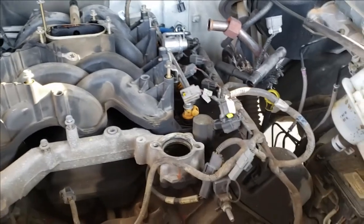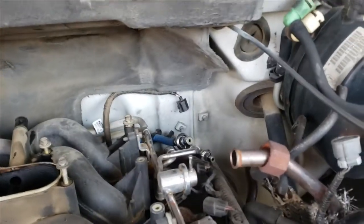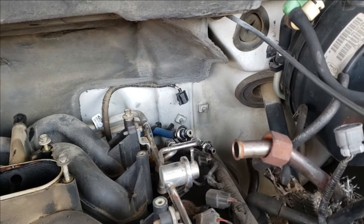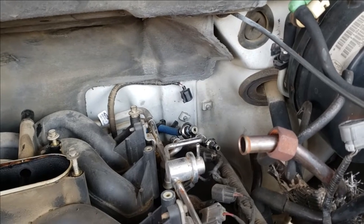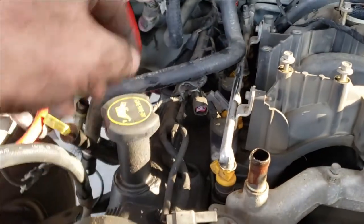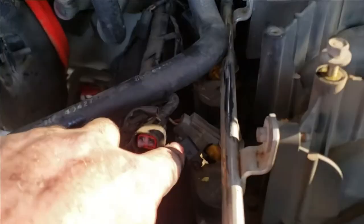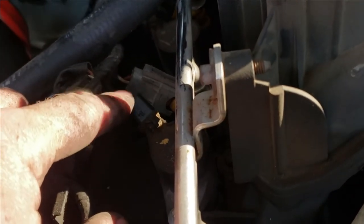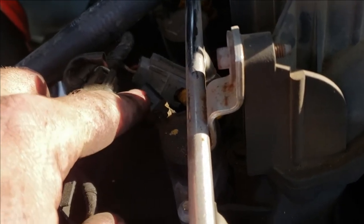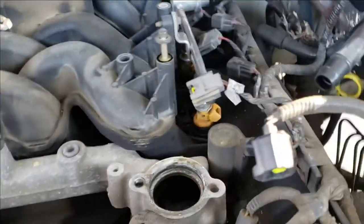Removed and unplugged a lot of wires and stuff. The fuel lines are disconnected back there — you'll need a special little tool to disconnect those because they're locked with a spring. It's a little plastic tool you can get cheap at the auto parts store that clips on the fuel line and slides between the spring and the fuel line to let you pull it off. Unplug all of your injectors and unplug all of your coils. These are coil-overs, which means there's a spark plug under each one — this is your ignition coil for this cylinder, and all eight cylinders have one.